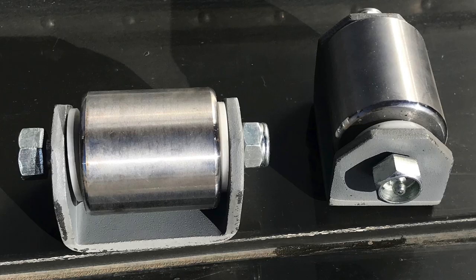I did some research and found some wheel casters from a supplier named Renthound. There are several suppliers that offer similar products. These wheels have a housing that is two inches by three inches and the roller extends a little over two inches after being mounted to the trailer frame. You don't want to mount the wheels clear to the back end of the frame — they need to be placed three or four inches forward from the rear bumper and the end of the frame.